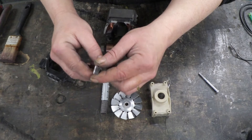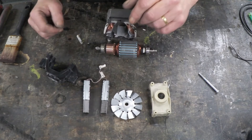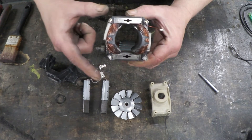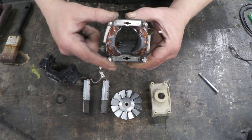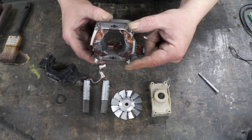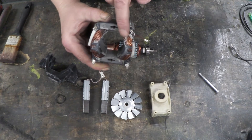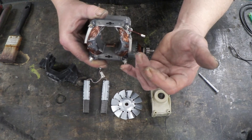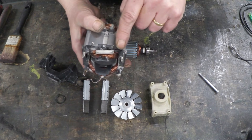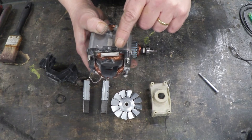You need to have a quick inspect of the brushes to make sure they're nice and clean, not cracked, not chipped, not broken. If they are, they're really cheap to replace — about a pound or two. When I checked the continuity with a multimeter, one coil had a resistance of about 1.4 ohms and the other had infinite resistance, meaning there was a break in it. These things break because they get overheated — the insulation burns through and you get a short. Very frequently they break at the crimps, because that joint becomes more resistive than the rest of the coil.